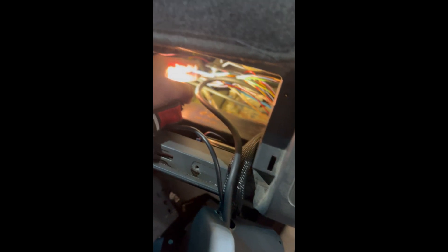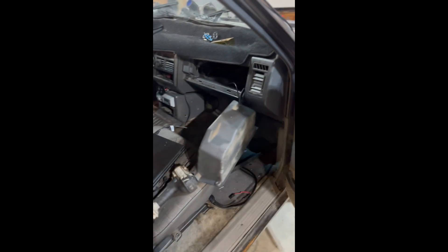And then there will be a thicker gauged wire which is your main wire that goes to your ignition coils, your injectors, the idle air control valve — all that through the harness. But you will have to take extra wire and wire it from your ignition to your harness, which I will show you here in a second. I have my wideband ground grounded in here to the dash bracket. And that's that.